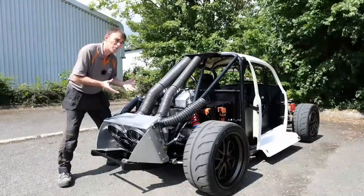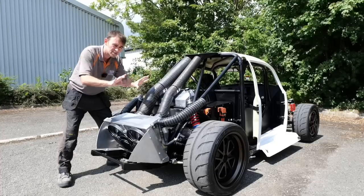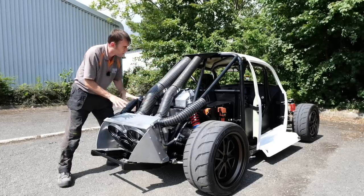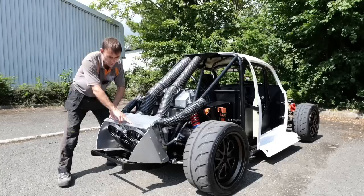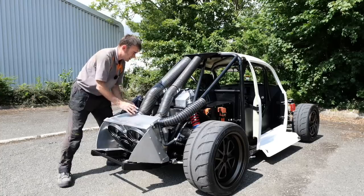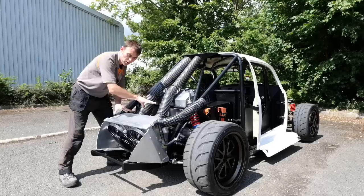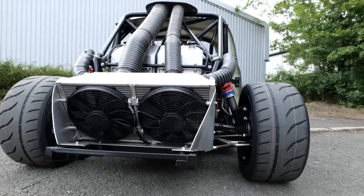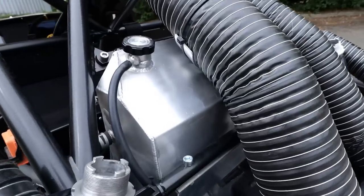One of the problems with a beetle shape is that because it was air cooled there was never a massive grille at the front to put a radiator. So on the fun cup cars which this is based on, we've got a roof scoop and some side scoops, and we've used these for the rear radiators. This radiator here is for the motor and inverter, and that header tank is for that. These big pipes are scooping in air, throwing it into the air box, and out comes the heat. We've got some fans here — suck fans — just to switch on if they need additional help. And then we've got another header tank which is the battery coolant system, with the radiator up front.